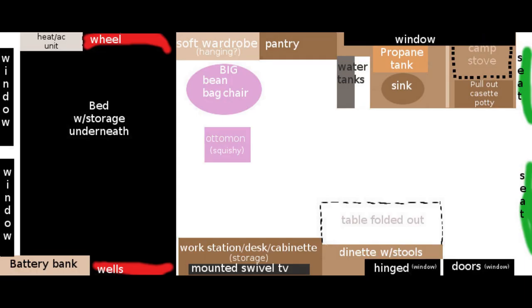Let's go to my plans for the van. This is not to scale — these are just tentative plans for placement. The little white arrows are pointing to the two front seats. This area is going to be my kitchen area, in front of a window that I'm not going to cover up, and this window opens, so that's good. Over here, I want to put the cassette porta-potty underneath, and up top a hard surface where I can put my cooktop and use as a food preparation area. Here I want to put the sink — I'll cut a hole in whatever surface is there. I want my water tanks here, both clean and gray water tanks, and a little foot pump water pump so I don't have to use electricity.